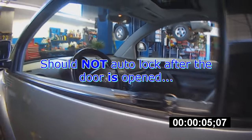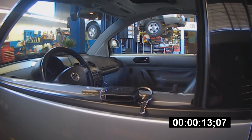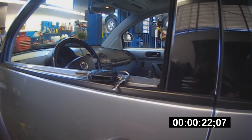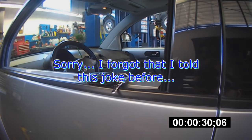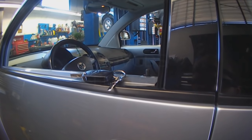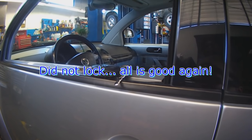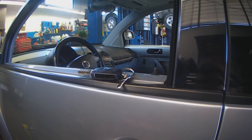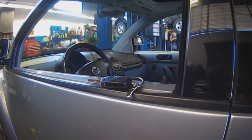Now I'm going to do the same thing — unlock, open the door, dome light is on. Now the alarm module, the comfort module, thinks that a person got into the vehicle. So we're just going to wait 30 seconds and it should stay unlocked. What did the cow say as it was about to pass the horse on the farm? It said 'moo-ve over.' That was about 30 seconds. You can see it did not lock because it's anticipating a person in the vehicle about to start it. Self-awareness — SkyNet, just around the corner. Thanks for watching, have a good one.